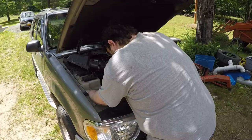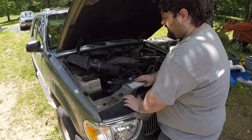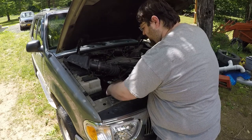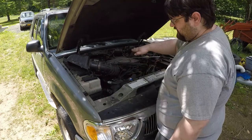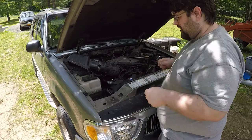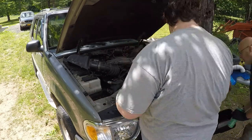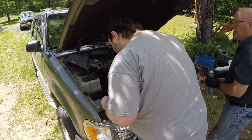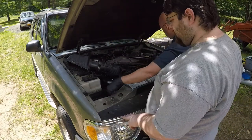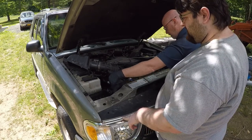Thanks, Ford. So, the airbox on these, in case it's not described in a previous video, has two mounts, these little hook things. The hook things pop right off. The top shifts up this way, and then it goes up and out. There are four grommets. Spray them. Didn't we just do that last time? I'm just telling whoever tries to do it: spray it with lubrication from the top into the holes that you can see, which will allow the grommets to loosen up.